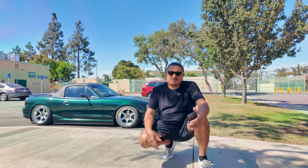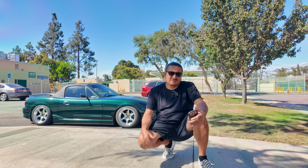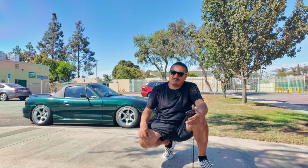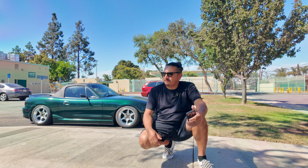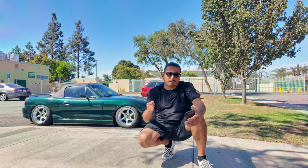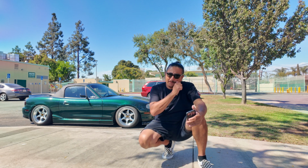I got all these center caps put together, and when I went to install them, the front ones went on just right. They were perfect because the measurements that I took were for the front center caps that I was replacing. The rear, on the other hand, I ran into an issue with the axle nut. It was making contact with the counterweight, so I used a Dremel with some burr bits and just went at it until I shaved it down enough to clear.